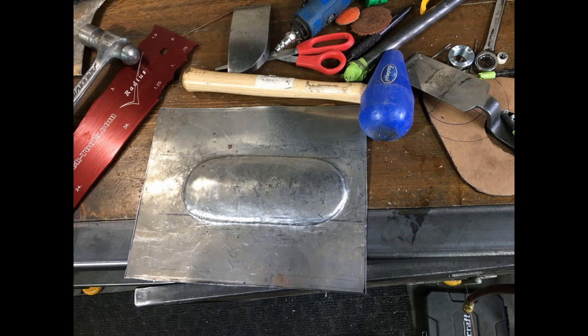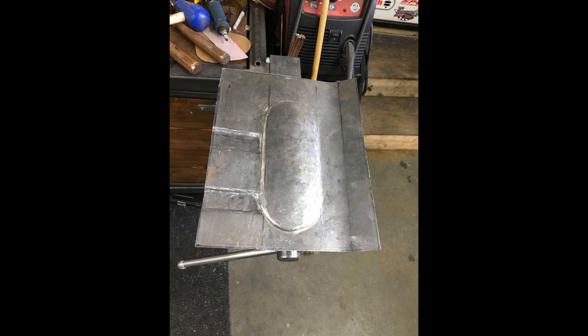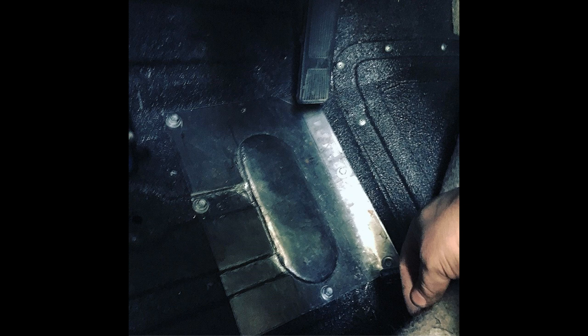What I ended up doing was taking a piece of flat sheet metal and mocking it up in the car from underneath, then drew a circle around where the master cylinder sat. I opened up the jaws of my vise, took my air hammer, and ran it along to create the oval shape you can see. After I had a nice groove in there, I took the teardrop hammer and the sandbag, beat on it, and then hammered and dollied it out flat. I then did the same thing with the vise doing reverse beads so it matched up with the factory floor. I'm pretty happy with how it turned out — I'd never tried anything like that before and it really worked out great.